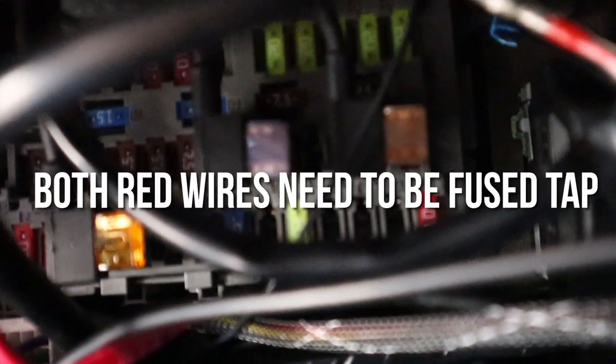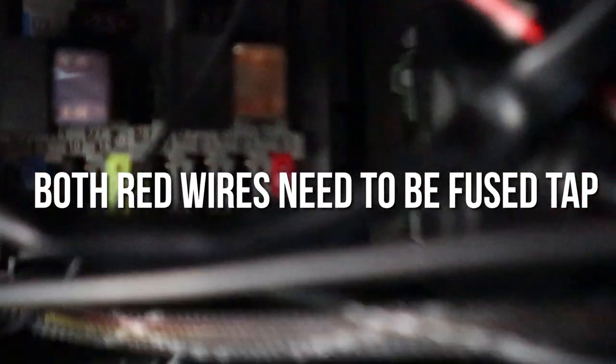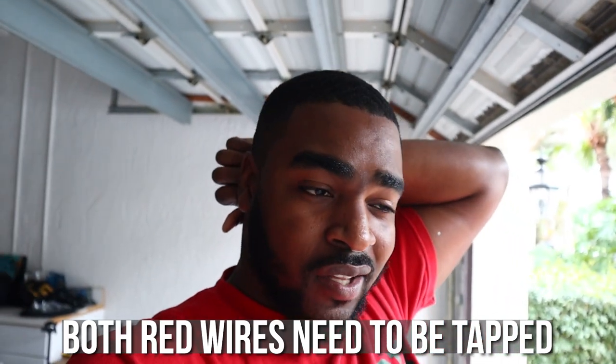A few days have passed. I was having a little difficulties wiring everything up and I finally got it figured out. As you guys can see — pay attention to slot 29 in the fuse box. What I did is I tapped it with a 7.5 amp fuse and a 5 amp fuse tap. One of those wires connected to your AEM gauge is gonna be for power. There's gonna be two red wires — one red wire for power, the other goes into the ECU if you have something going on there.